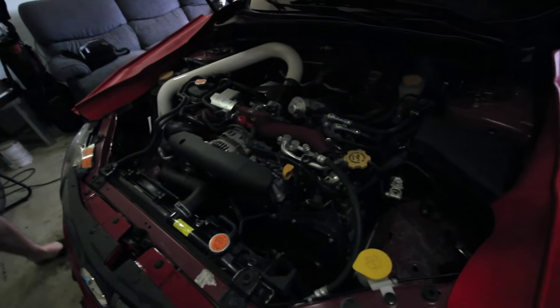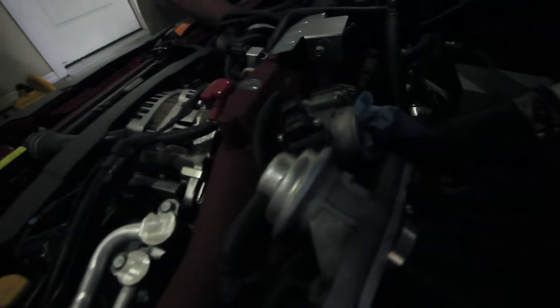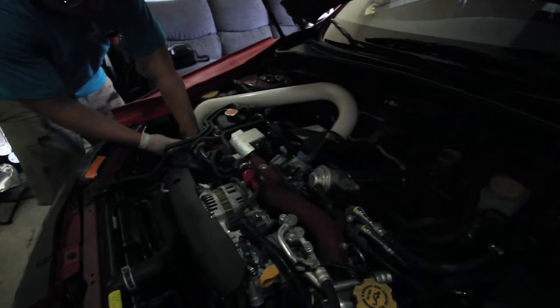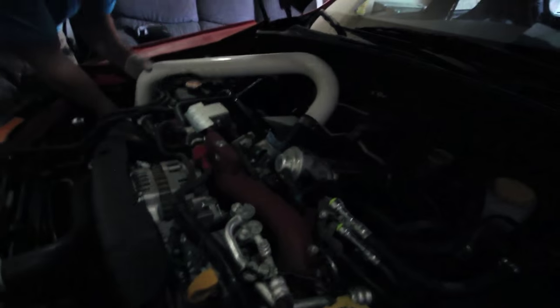We could get rid of all this stuff, but look how many lines. That's what blows my mind. Subaru does some funky stuff because it is a boxer - crazy stuff going on here. It has two fuel rails and it is a factory return system. Back to work - put a little towel to clog up where the throttle body is, right over the intake manifold. That's not good if bugs crawl in there, so we're just going to plug that up. My factory bypass valve is just so awkward, just sitting there.